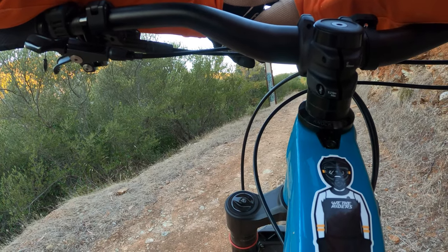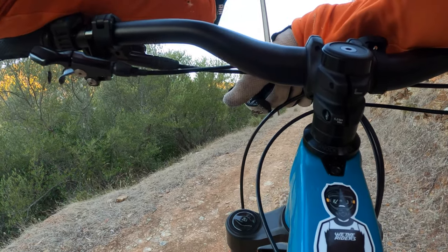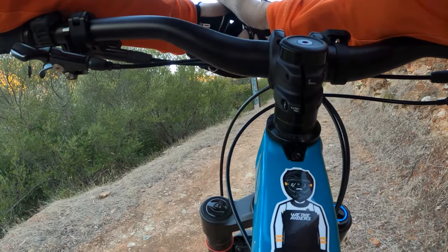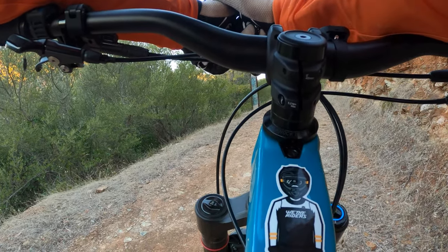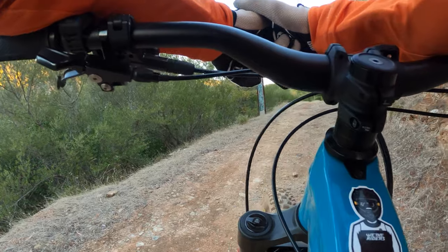The only reason I was steering wide in corners is because of the little bit less compression at the front. So a little bit less compression makes the fork a little bit less precise. A little bit too much makes it choppy, depending on relative to your spring rate. So you can't have just all spring rate and no compression because it'll just float around at the front. You can't have all compression, no spring rate because it'll be just harsh and dead.